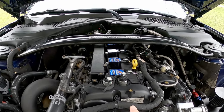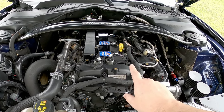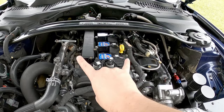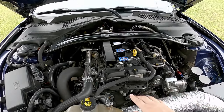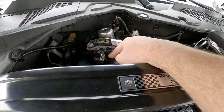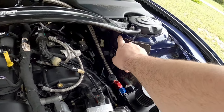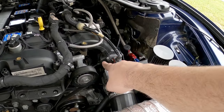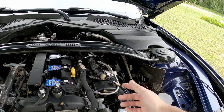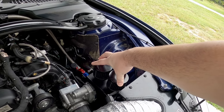I'm going to give you a little update. If you notice something, there's something a little different in Buster's engine bay. Both catch cans — the one over here and the one over here — they're no longer there. I decided to see what happens if I remove those catch cans. Instead of having one catch can for the breather outlet on the valve cover that goes into the charge pipe before the turbo, and the Mishimoto catch can that goes from the baffle on the side of the engine into the intake manifold, I thought removing them and plumbing the baffle straight into this baffled tank would be beneficial.